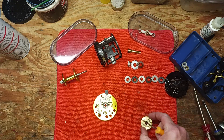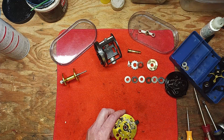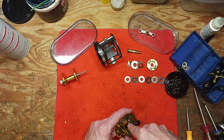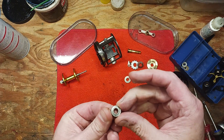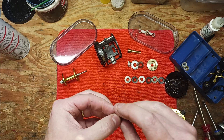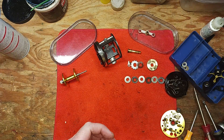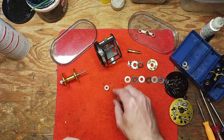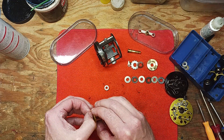You've got the clutch kit, the main gear, and then we've got this bearing here that we want to get to. We're going to see if we can gently take this out — which we can. This bearing doesn't feel bad, but spinning really really fast for many many years can do a lot to these. So one way or another we're going to measure that and do the other one as well.